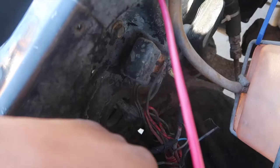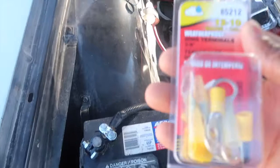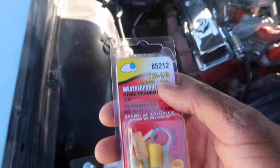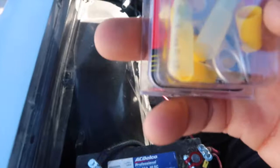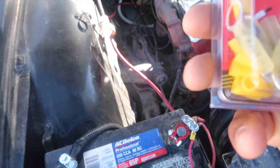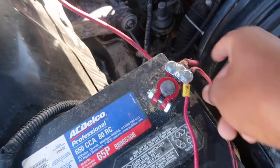After that, that's all you have to do for this conversion — it's simple and easy. Get one of these connectors, make sure it says 12-to-10 gauge wire — because if you use 14-gauge it's not gonna charge it up and the next day it won't start. These are the big 3/8-inch terminals. I got the big one because of my audio system, but you just need a small one like that one right there. I do recommend you change out the terminal when you do this.